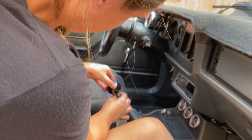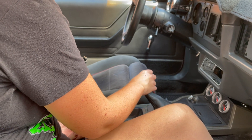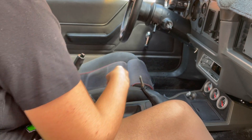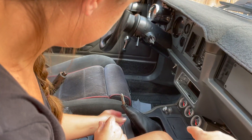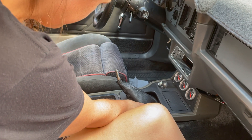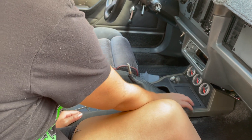That's basically the piece where you stop it so the shift pattern looks right when you're in there. Then go ahead and pop the surround — see how around the shifter it's like a separate piece? Go ahead and pull up on the plastic around the leather, not on the leather itself.